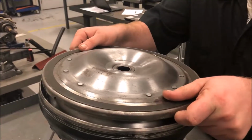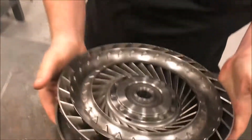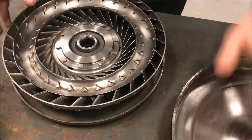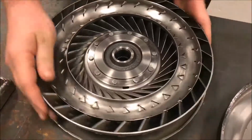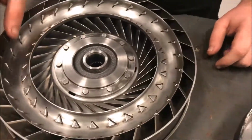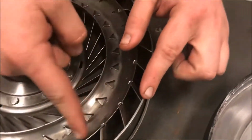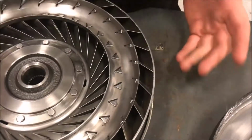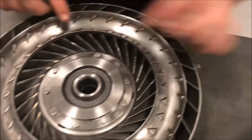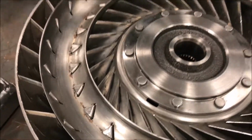And this is the turbine. So I'm going to take this off and look right here. The transmission, these two are together with the engine. So it's spinning all the fluid going around like that, and it's spinning it throughout the transmission. And this plate right here is pressed on, and all these lines are bent over, not welded. Only in high applications, high horsepower, they'll be welded, but they're bent over like this. And it spins the fluid throughout the transmission, and it's locked in here with it.